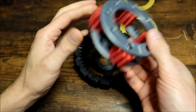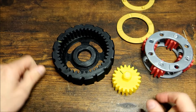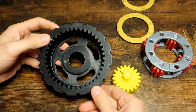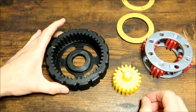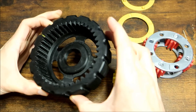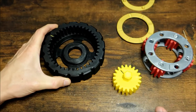And that's because of the way they're mounted on the carrier assembly. So that's the carrier assembly, our sun gear in the middle. And then finally, we have what's known as the ring gear assembly. They have these internal teeth that face towards the inside, and that basically encapsulates everything. If you notice these little notches on the outside, this is just to represent how this could be splined to a transmission case, or be part of a clutch pack that can either hold or release this.